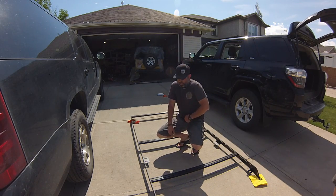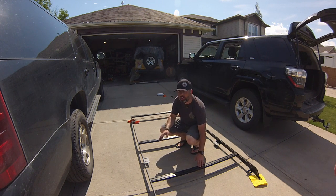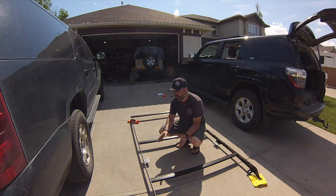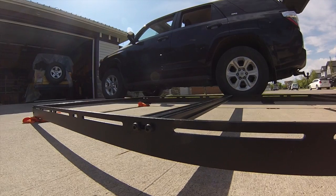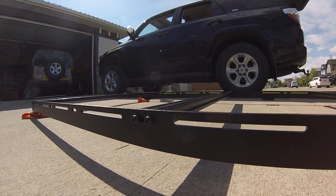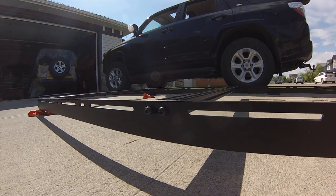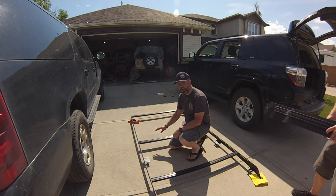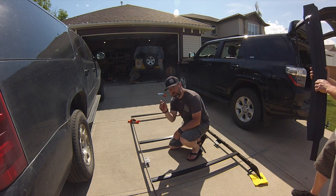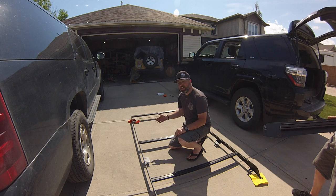So hey, what he's done, he's already installed the 2 side pieces. So this is made out of aluminum, and it's powder coated with aluminum extrusions in the middle. So the instructions tell you that you install the back, front, and then the middle. And the thing is, you'll see some long slots and some tiny slots. The tiny slots is where your 2 bolts go into. Now with your kit, you'll get 9 crossbars. So you'll see that the small slots, there's actually 9 of them. Well, 18 because it's a pair, but there's 9 slots.